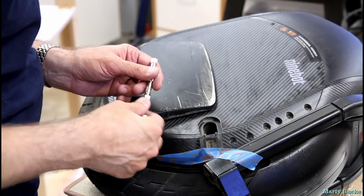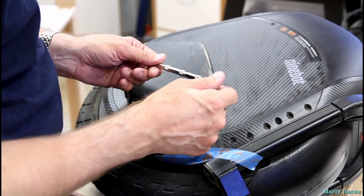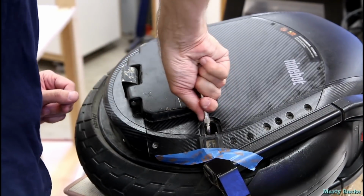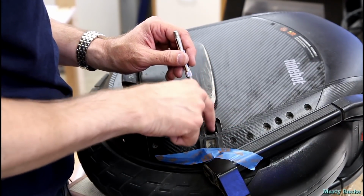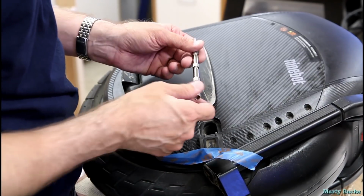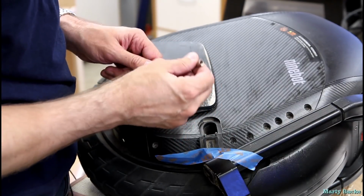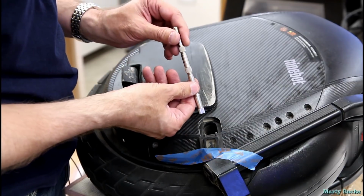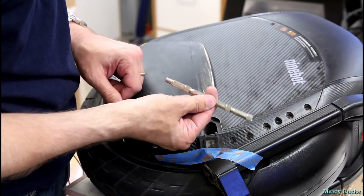Now if you watch Chooch, what bothered me a little bit was how he filled this tire with the extension. He wasn't using the one that came with the wheel, he was using another one. But if you watch him, he would stick this in here, and he'd say you have to really press down hard and screw it on. And I don't like the idea of doing that. Last thing you want to do is damage that valve buried deep in this wheel. It's not going to be fun to take this wheel apart to get to the tire. And apparently the valve pin doesn't fit all the extension tubes, and that's probably why he had to press hard to get it to engage. But this from Slime works beautifully.